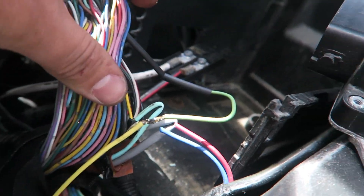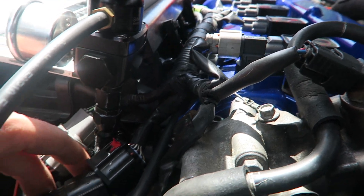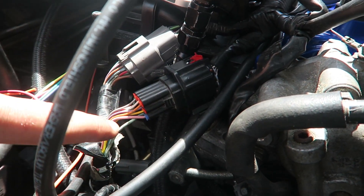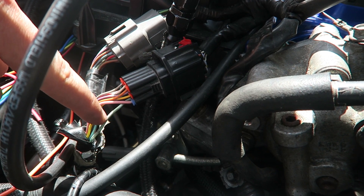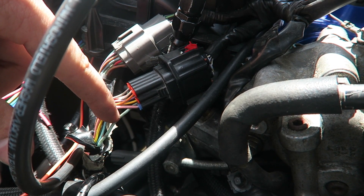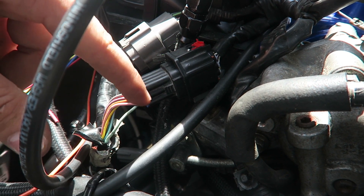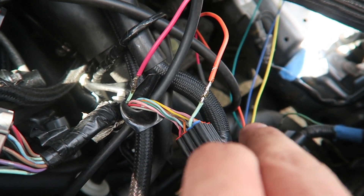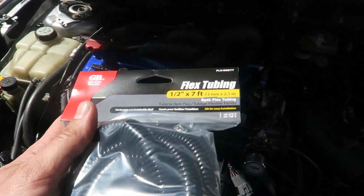Last but not least, for the red and orange wires, find the connector going to your coil harness. On the very bottom row, second from the right, there's a small teal wire — cut that in half, leaving about an inch on each side. The side still connected to the harness gets the orange wire soldered to it, and the other side gets the red wire. Basically you're intercepting the teal wire: connector side gets orange, other side gets red.